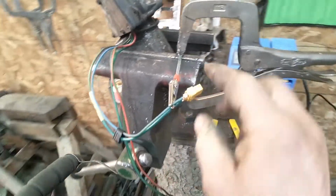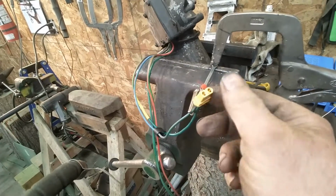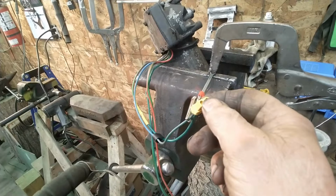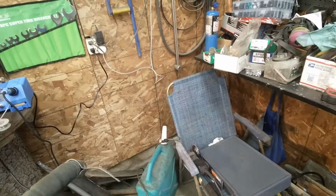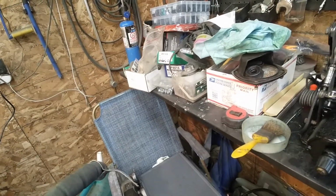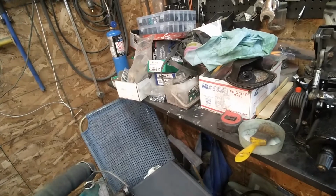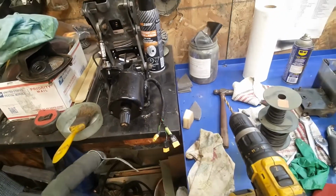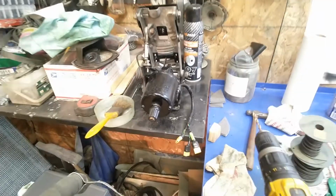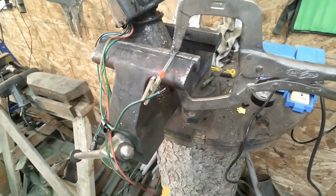And then I've got this end here soldered on two wires. The blue one goes to the bottom, and it's got a female type end on here. Same idea that I did here, female end. For all this motor stuff, I've got female there and two males on it. And with the headlight stuff, I'll put female on the headlights, which I've got prepared down there, and male on the inside, so you can't get them mixed up, eh? Anyway, that end there is hooked on, ready to go.